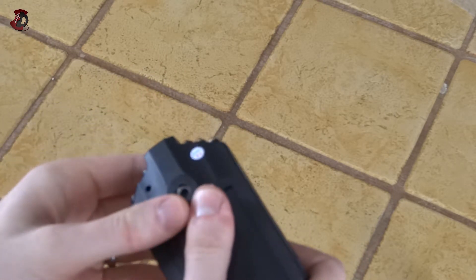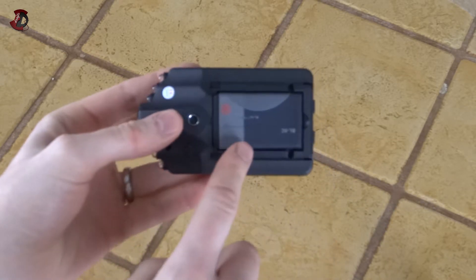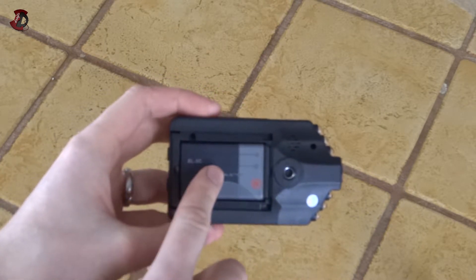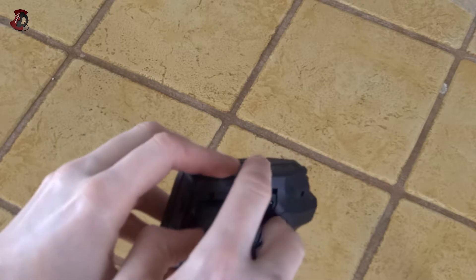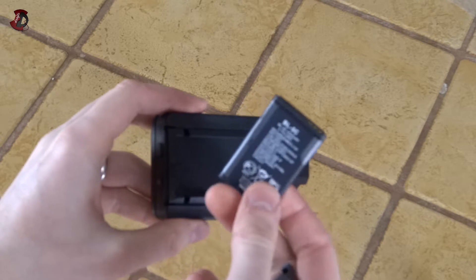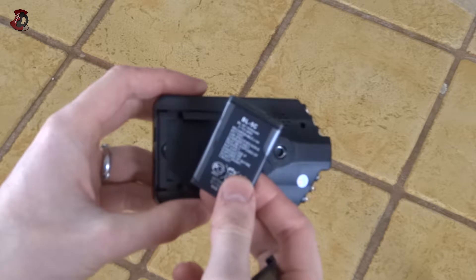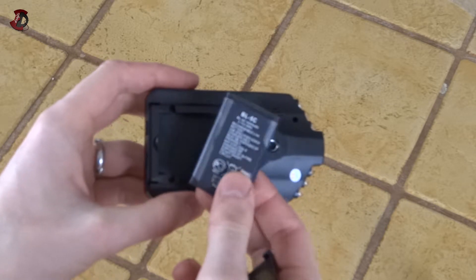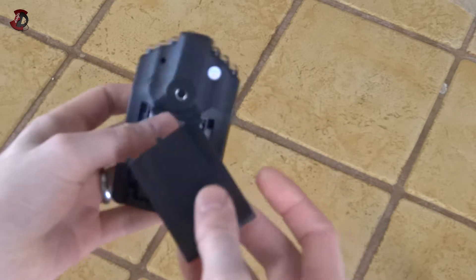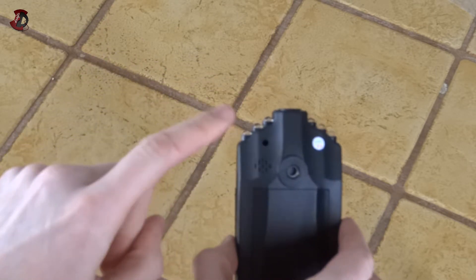Back to the actual device — I'm going to show you what's inside. Obviously you have a battery. To me it looks like a Nokia battery, or at least a knockoff Nokia battery — the BL5C — so if you have old Nokia phones lying around this might be useful. The battery is 3.7 volt, 1020 milliamp hours, and it's a lithium battery according to the label. Made in China. I don't know how good the battery is but it does work, so that's the main thing.